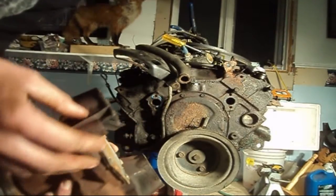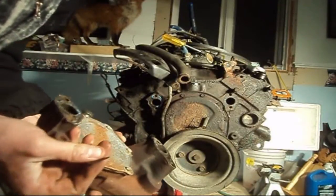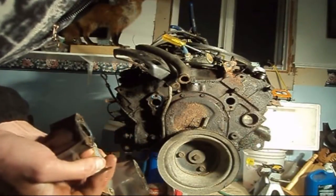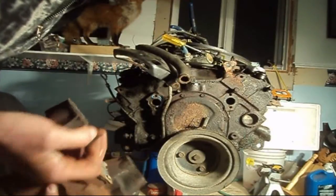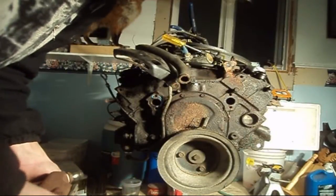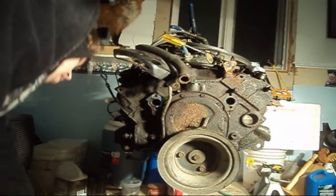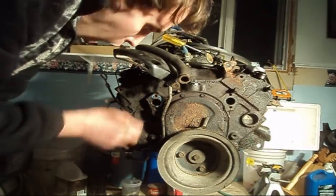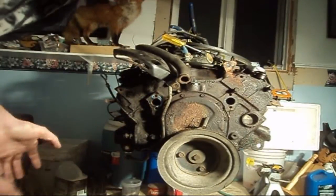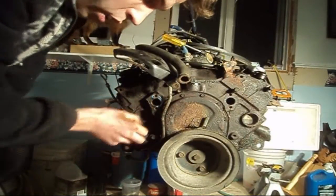Now, you're going to have gaskets in behind here. These gaskets are old and brittle. What you're going to have to do is take a putty knife and scrape these off if you are replacing your water pump with a used one — say maybe you had to gain access to your timing chain cover and your old pump has to go back on. You're going to have to scrape these clean. If you're putting in a new pump, you'll be alright. But you will notice there are remnants of the old gasket against the block — you've got to clean that up. You can't leave that stuff on there or you're going to have a leak. Clean that up first and foremost.